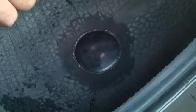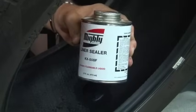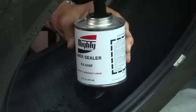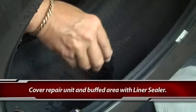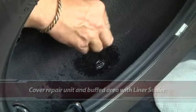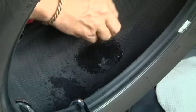You have now repaired the inside of the tire and the hole that went through the tire. The last step on the inside will be a repair sealer — the Mighty Liner Sealer, which is liquid synthetic rubber. Clean the brush as it comes out and paint it around the area where you overbuffed. This replaces the rubber that you buffed off with the buffing rasp and seals off the edge of the patch.